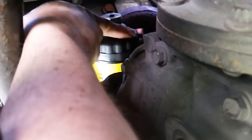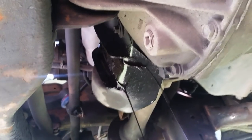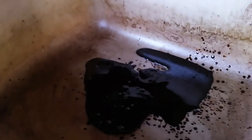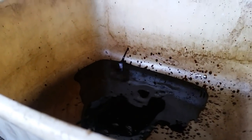All right, I think we got it — yeah! All right, there we go, that was a little scary. I'm going to pull this back off and see if I can get my hand up there. Now if I can just turn this, we'll go ahead and spin it off and let the oil just kind of drain out. When you take these oil filters off, let them drain out — just let it run down into the pail. Trust me, you'll be a much happier camper.